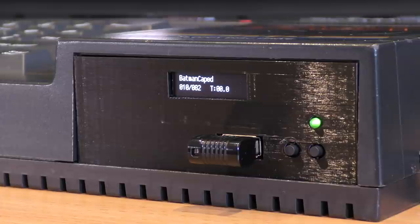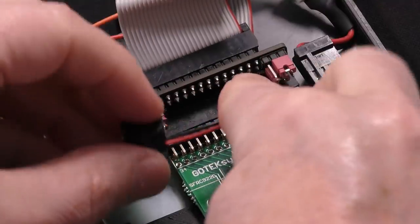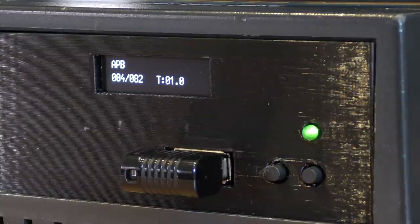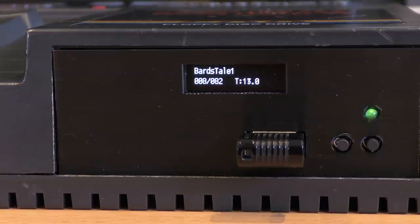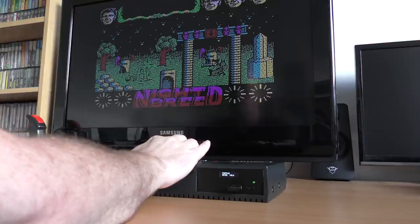You may have noticed there's no sound when loading because there's no physical mechanism — but you can actually create one. Buying a cheap piezo speaker for about £2, you set the wires into a jumper and plug it into the pins at the back of the GoTek. This will generate a disk noise when the files on the USB are being read or written to. Mine is very quiet — I may have bought the wrong sort of speaker — but it does make a sound. The GoTek can be purchased from various internet sites; I got mine from eBay and I'm very pleased with it. It mixes modern, reliable electronics without changing the way the machine works, maintains the aesthetic with nothing hanging out the back, and is a great addition to the Spectrum Plus 3 if you want authentic operation with a more reliable option.